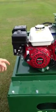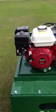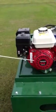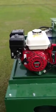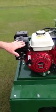And if that happens, that means that you don't need the choke in. Then pull it out again. Now give it 30 seconds to tick over.